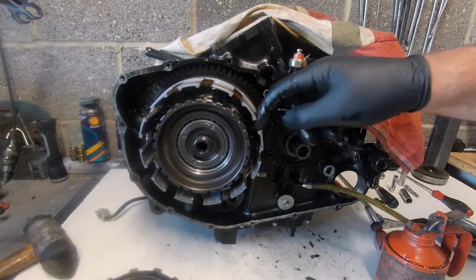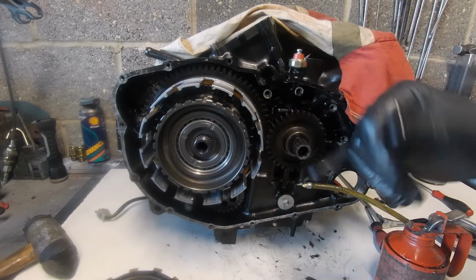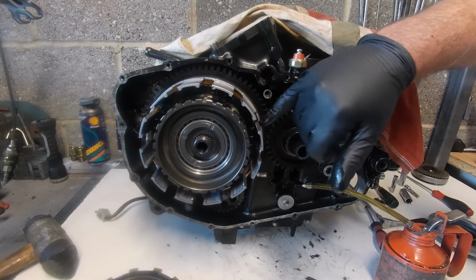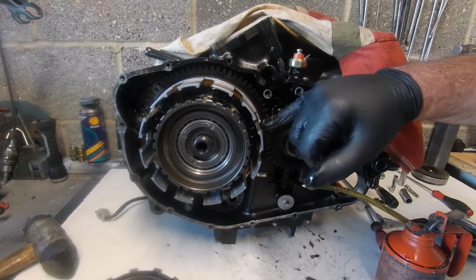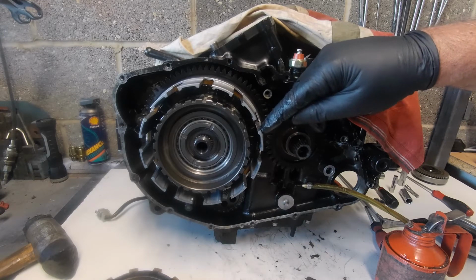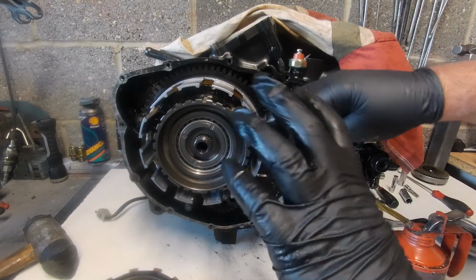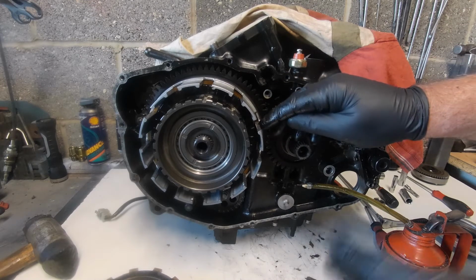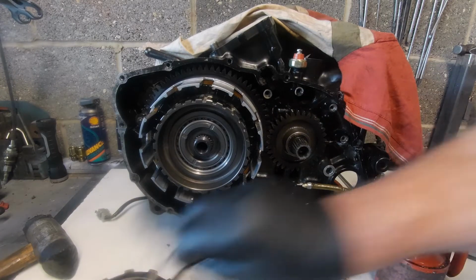We haven't got too much of an indentation in here. In the days when I had some worn out TZ stuff in car racing, what used to happen was that the plates would bite into this clutch basket, and even though you released the clutch and it lifted the plates from biting together, the situation of the drive forced the clutch plate to drop back into its groove when it's normally compressed, and it was really difficult to change gears. So it's worth thinking about that.